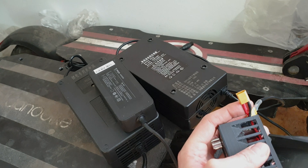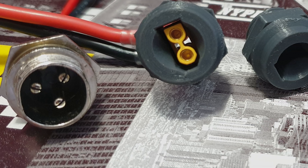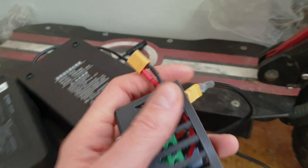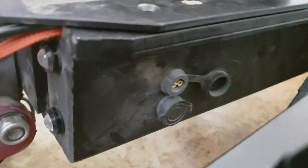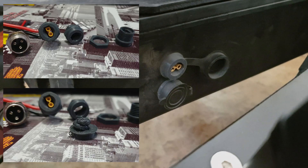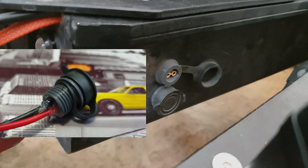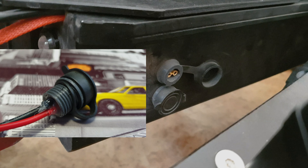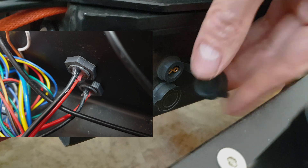Also, don't forget about the connectors — in stock scooters we've got these microphone connectors which are quite dangerous to use. That's why I changed the connectors in all my scooters to XT30, like over here, and you can even see it in my Yanobike T85. I'm releasing this project next week so you'll be able to download and print them — they fit on the stock port, just remove the old connector and place the new one. It's much safer to use with no risk of short circuit.